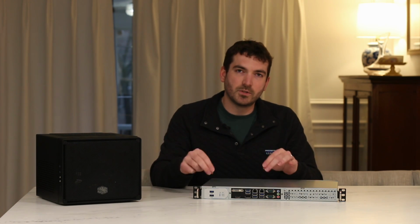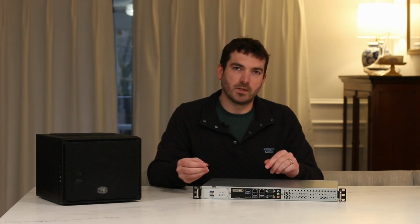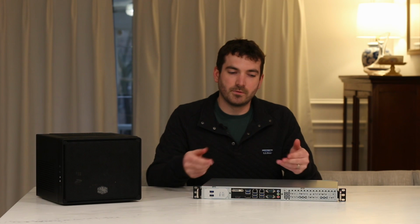Specifically for this processor, I was looking for the push pin type CPU cooler. So once I found the new 1U cooler, which I'll also link below, that had the push pins and it was a great height, everything just sort of worked better. I still had to push the CPU cooler onto the motherboard before screwing it down because I was running into a little bit of fitment at the bottom, but once I had the cooler on, screwed down the motherboard, it was totally fine.